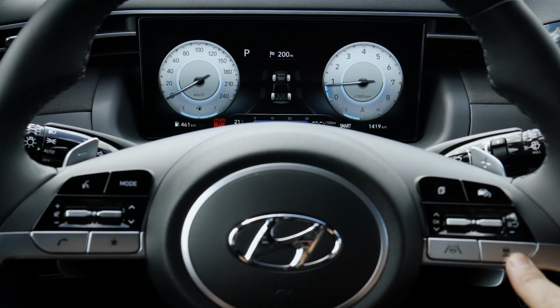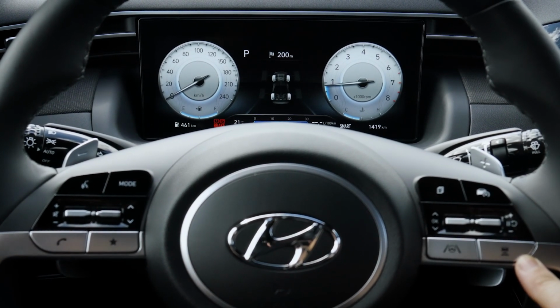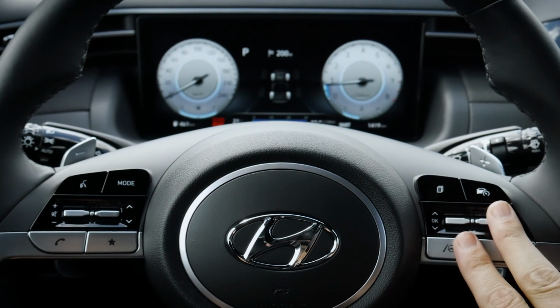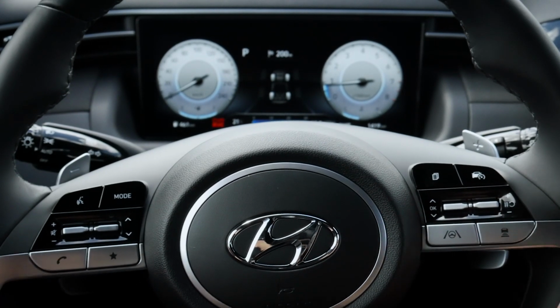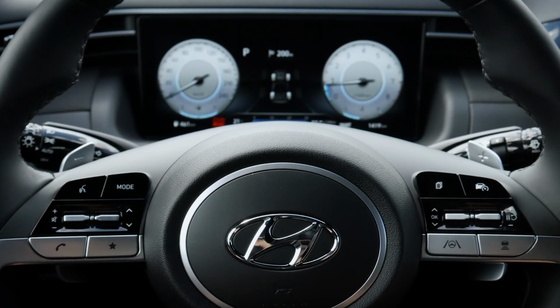This one is our distance indicator. So how close or how far are we away from the vehicle that's in front of us? And then lastly, we've also got this lane centering button. So the lane centering button is an interesting one because we've actually got a lane keeping system that technically works 2 different ways. Way number 1, with the base system activated, it almost works like a bowling lane. So if the vehicle senses that we're veering into another lane without signaling, it's just going to gently pull us back into our lane.